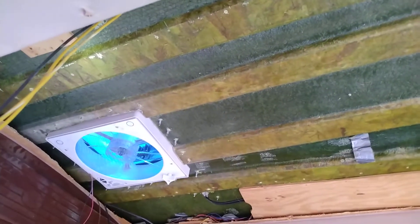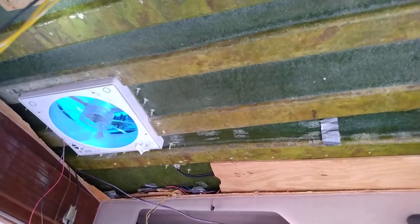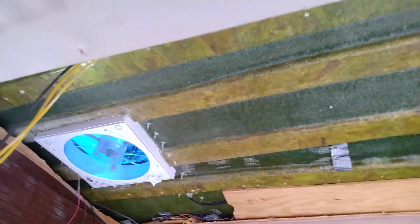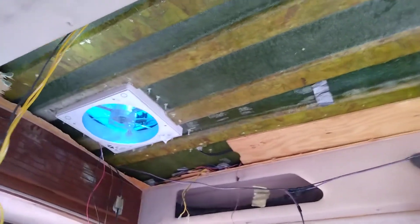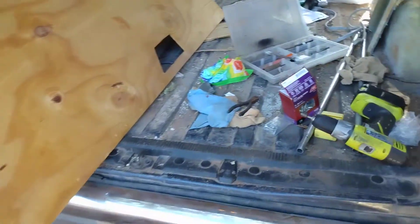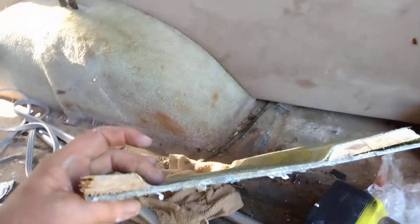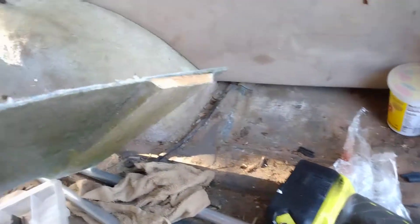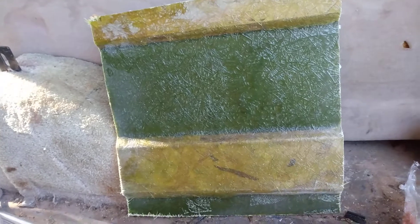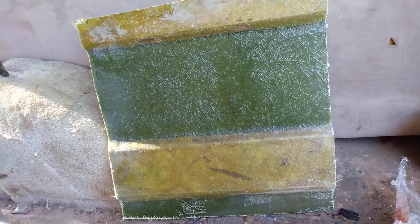I had to take out the roof on the inside of the van so I could see where to put things, and I'm glad I did because I didn't realize the top had wooden supports. If I had centered it exactly like I wanted, I'd have cut through two supports — as it was I had to cut through one. I got real lucky that this is a fiberglass-topped van. I was able to use a skill saw to cut through the fiberglass roof and the supports instead of a jigsaw, and it made it easier. I put the gland in on the roof.